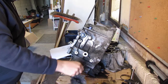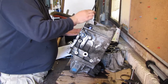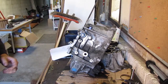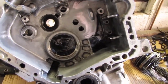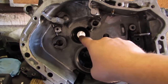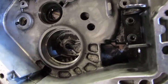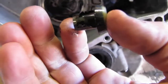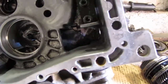I've made some progress while my SD card was copying files. The inside of the gearbox is now completely empty apart from a bracket still installed. This is where the primary shaft goes through to the clutch, and this is the location of the secondary shaft. Bear in mind there is a plastic bushing inside — you can pull it out. There is some damage to this bushing; I don't know if it's normal or needs to be replaced, but I'm going to ask the price for a new one.